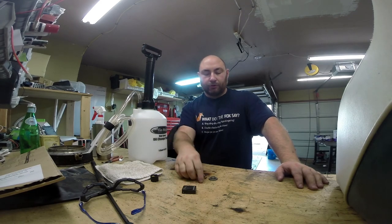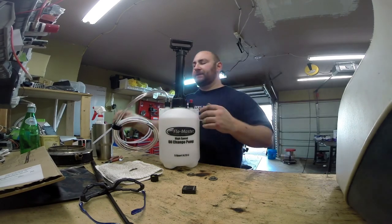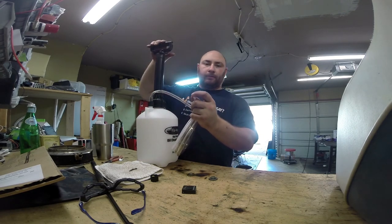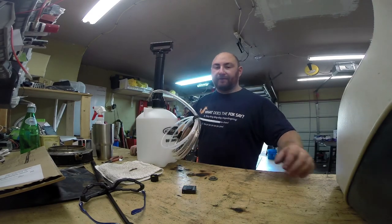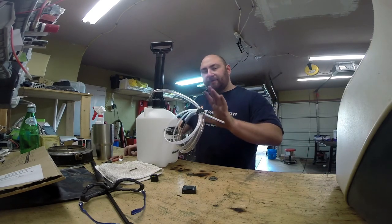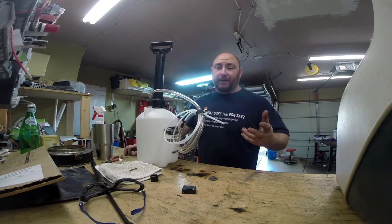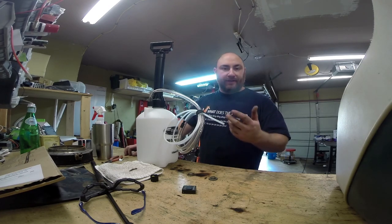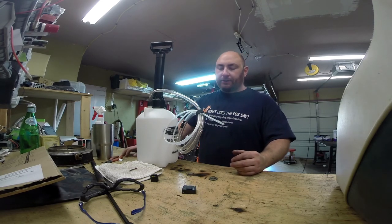Because all the interior is stripped out, you have to buy one of these — vacuum based oil change systems. The idea is you catheterize your engine and then pump it to create a vacuum. This is good for five quarts, which covers a normal V8. I am not a fan of these systems — I'd never recommend one on a car because gravity gives you a better drain and gets all that gunk out. But on a boat where the underside of the engine is really inaccessible, these systems are necessary to do a good job.